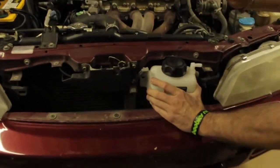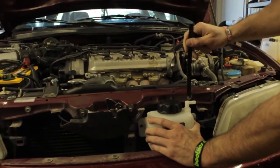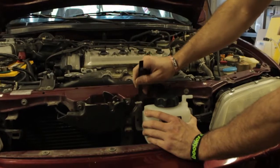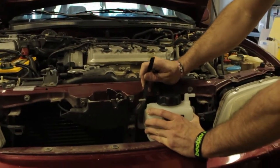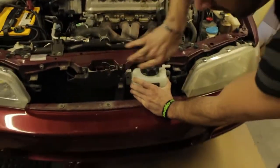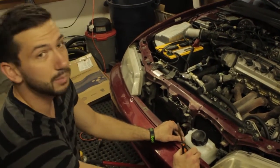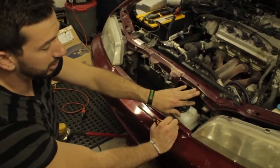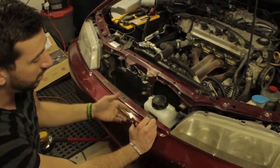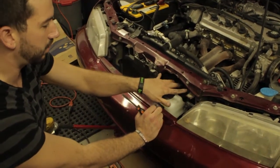We've got this piece — it's just some scrap metal lying around. It's flexible but very sturdy, and once you get it in there it's not going to go anywhere. Basically we're going to mount a piece here and a piece hanging here to hold our main reservoir. We've already checked to see that this piece can come back on the front when this is all done. Sometimes you'll have to use methods that are a little more unorthodox, but the main key points are: get your tank mounted where it fits well, make sure you have clearance for your hose, and make sure it's mounted securely.